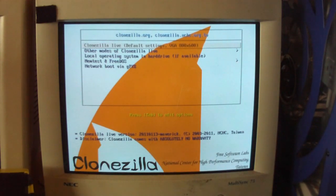So what's really weird is that if I plug it into my external recovery deal that you can plug hard drives into, it reads it perfectly, which is because it's this awesome piece of equipment. But I have another 160 gigabyte ATA hard drive that's used, and it's a Seagate, but it's not as bad as it sounds. It's an older Seagate, so it probably isn't completely horrible. But anyways, we're going to be cloning from the Western Digital to the Seagate.